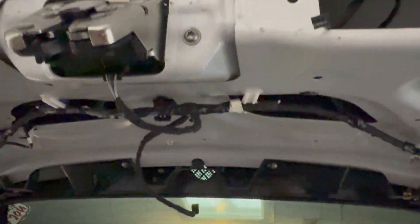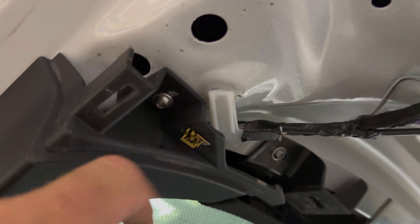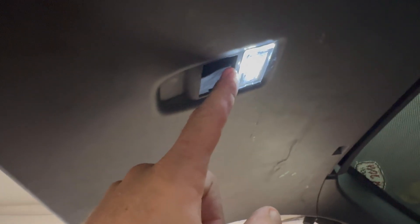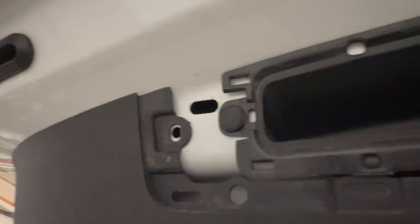Let's get this cover put back together. You may find when you remove the cover that some of the clip metal spring pieces come off — just get some needle nose pliers and carefully remove them, then push them back onto these tabs and they'll clip in. Make sure all the pins are straight and all the push clips are lined up. Also, do not forget to plug in the light first — otherwise it'll be very difficult to do it through the little hole. Then carefully line up the panel, start at the top edge, work your way down, pop it in, and put the two push pins back in. Don't forget to plug in the power button as well.